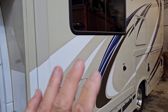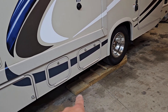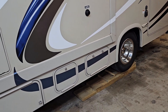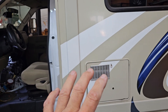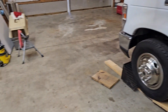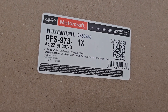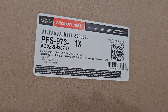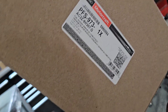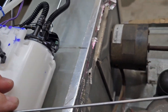Now a lot of you are like, 'oh man, I can save money, I can get a cheap one off Amazon.' Don't do that. This is an E450 with a 55-gallon tank — it's back aft, notice the vehicle is jacked up about four to six inches. This is continuously under a load, folks. The part number is PFS-973-1X, also AC2Z-9H-307D. If you look this up, it says for cutaway vans.